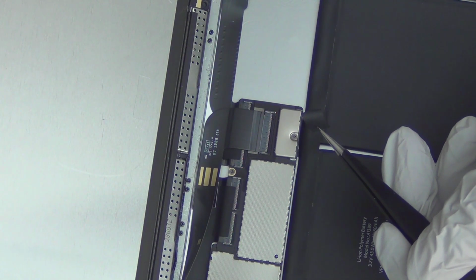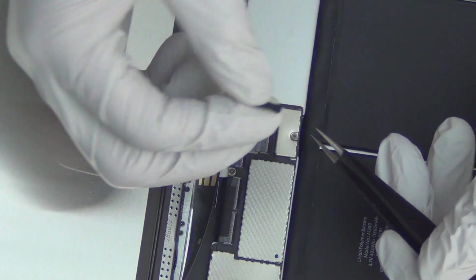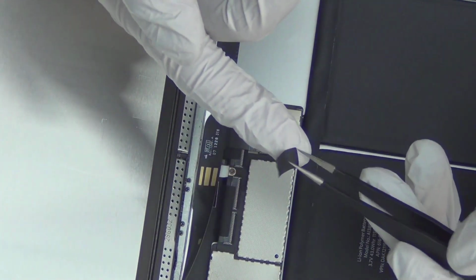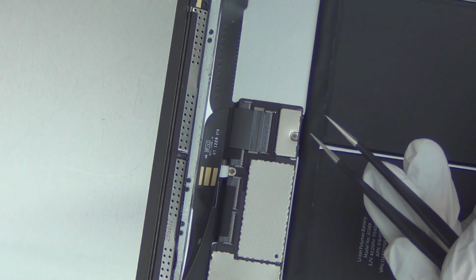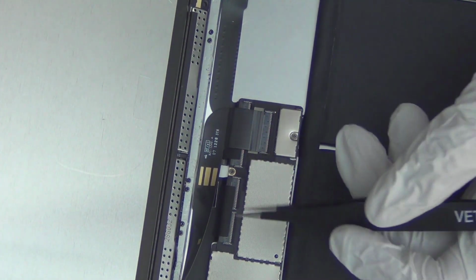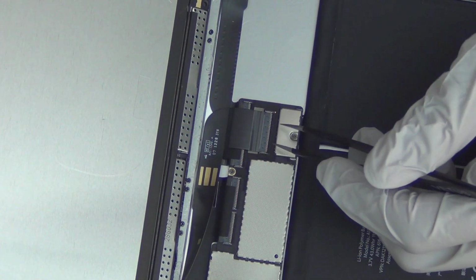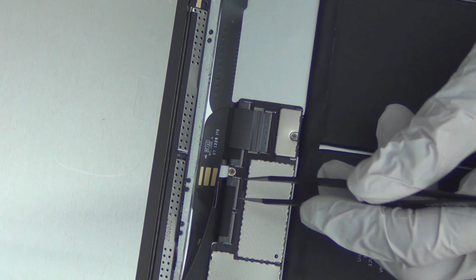It's kind of like paper wrappers for candies, or like plastic tape. The texture of this connector is a little bit stronger than this. It's a little stronger than electric tape, like a thick one. And so if you put too much pressure on it, it will crack and it will open. And once that happens, whether it's the touch connector over here, the smaller one, or the bigger one for the LCD connector, if you break those, you will have to resolder a new one.